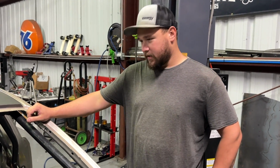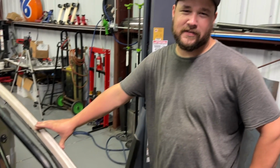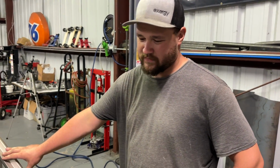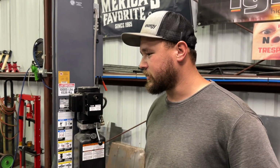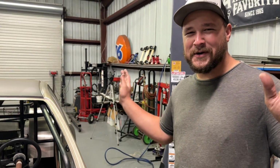So you want to tell them about the angle of the dangle on this whole deal? Yeah, I ain't no chassis builder by any means, but I think I've got the angle of it set right. We've got it in there at a 1 degree slant, and that should get us relatively close, keep our driveline angle where we need it throughout the range of the suspension. So as far as I can tell, it should work pretty good. When it doesn't, I want no part of this.